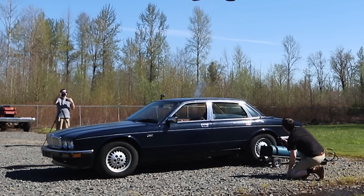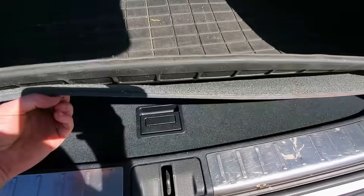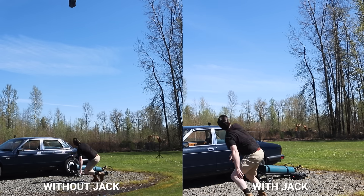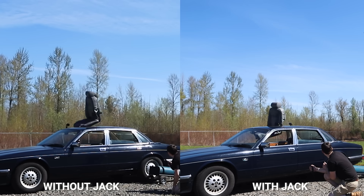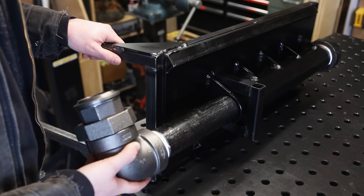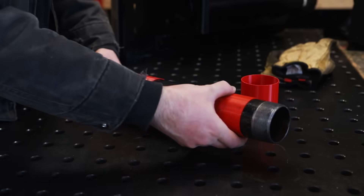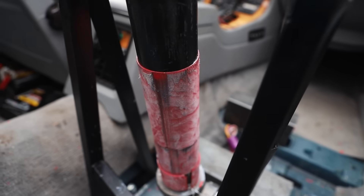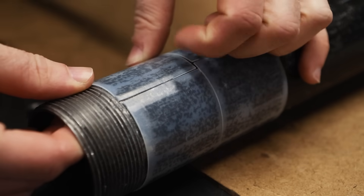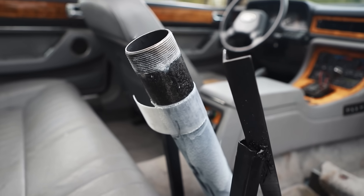Brandon noticed that the car was squatting quite a bit when firing — that energy was being wasted compressing the suspension. So I had the idea to rob a scissor jack from another car and place it under the floor where the cannon tube was. The difference in height was negligible, but the car didn't squat with the jack under it. I tried a couple things to mitigate the sloppy fit of the cannon sleeve — first printing a sleeve to take up the gap, but the plastic sleeve had to be so thin the air pressure ripped it apart. I next tried adhesive-backed UHMW strips to seal the barrel, but that also only worked for one test at a time and the gain in height was negligible, so I abandoned the idea.